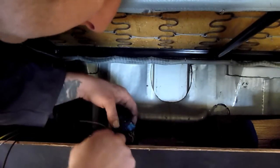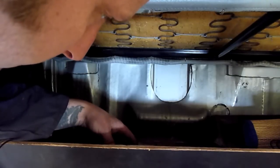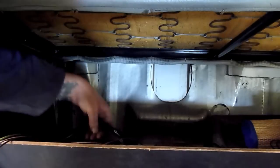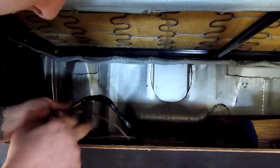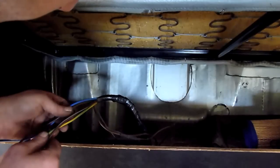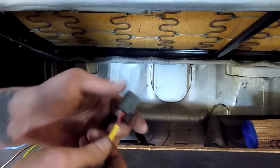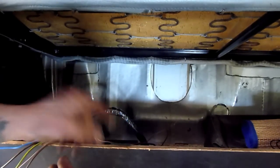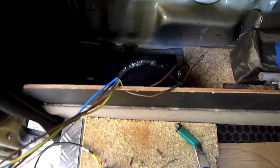Getting a little bit further on now. I've put a fuse at this end because I'm going to have to run a new cable front to back - it's never had power in the back. Tony's just turned up with a leisure battery and a ZIG unit. The wires to the pump are underneath - the green and the red stripy one, and the neutral. All the wires on the control unit from the wiring loom have now been extended and labeled, since he wants the control panel running up into the corner.